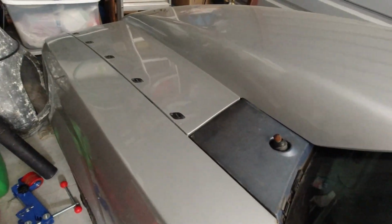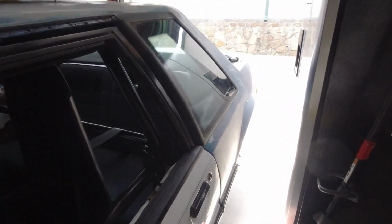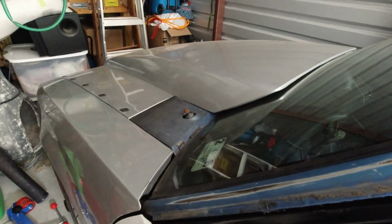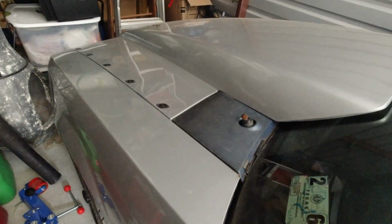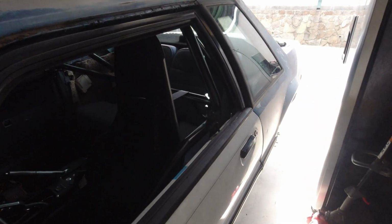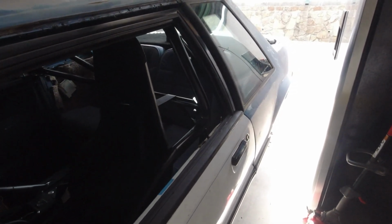So yeah, excited. Can't wait to see what this car does down the track. Hopefully we can run it, probably run it full potential. I have a duty cycle set up in the Holley I built. It shouldn't make any more than 9 pounds. But if the car feels good and everything, we will turn it up. Because this car, both its engines have seen 16, 17 pounds of boost. So 9 pounds should make this car scoot pretty good.